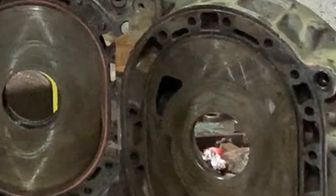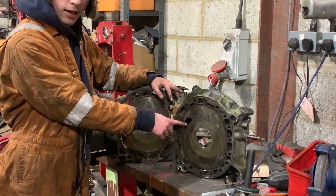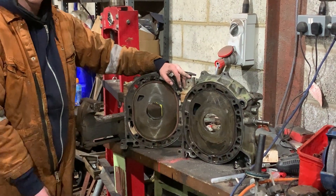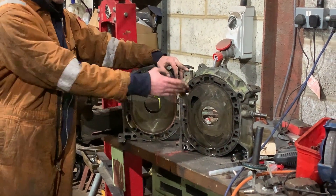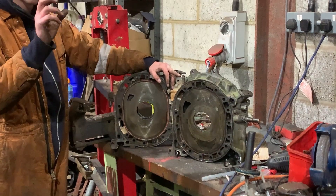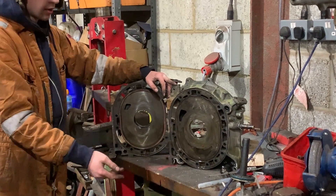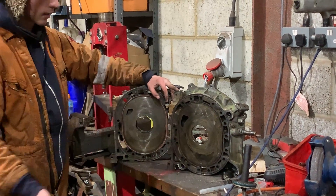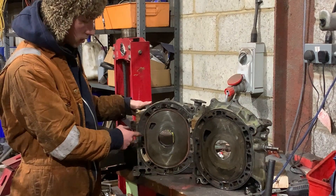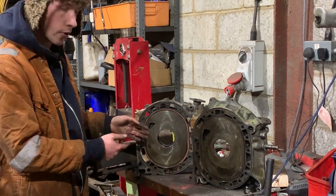For the intake, we have the primary ports and the secondary ports — they're both open at the same time. So if you go too big here, you can create overlap by gases passing through this port between the two chambers, making it wrap and overlapping. These secondary ports only get airflow going through them at high throttle openings — you have your staged throttle body, so normally air goes through the primary, and at high RPMs and high throttle input it goes through the secondary. If you go too big on the primary, you're going to affect your low RPMs and small throttle inputs.